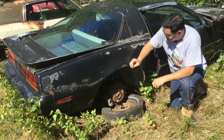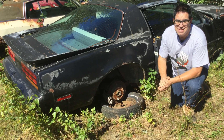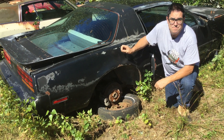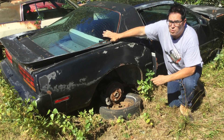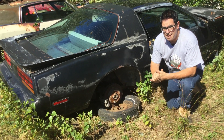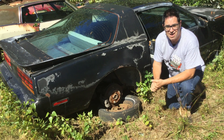Now we don't want to confuse this rear axle with the Dana 44, which is a similar-appearing axle. The Dana 44 has an eight-and-a-half inch ring gear — it's even bigger than this. The Dana 44 was sold over-the-counter at Chevy dealerships for folks who kept breaking their 7.62s in their IROC 350s and tune-port 305 IROCs.